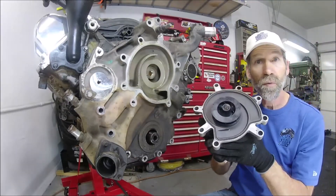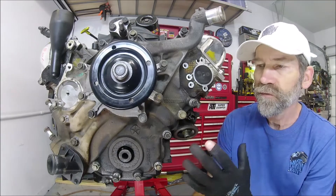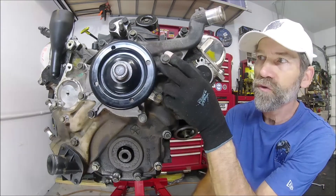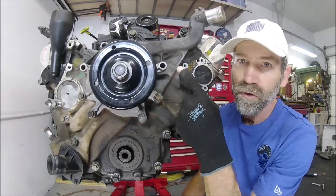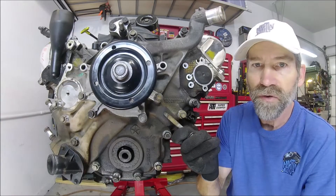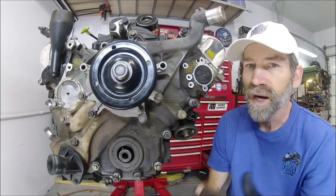There's how to remove a water pump. Something I want to point out: if you didn't want to remove your water pump, it isn't necessary to do that to get the timing cover off. There are only three bolts that you actually need to remove — those three right there. The other ones are just literally held to the timing cover themselves. So if you wanted to save yourself buying a gasket for the water pump, you could do it that way.